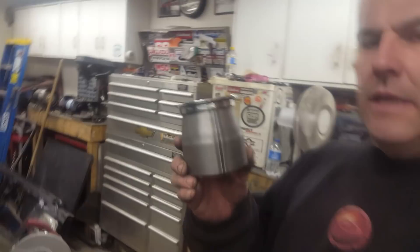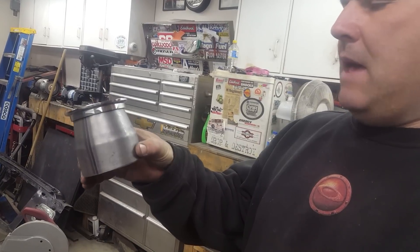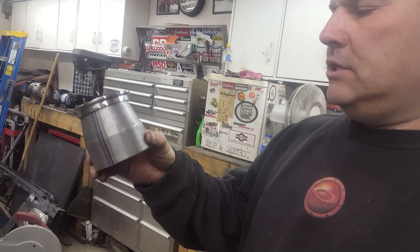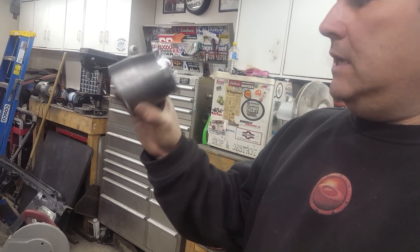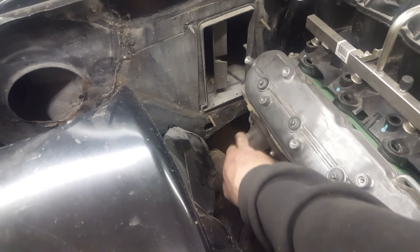I've got a V-band on there already. It's got a three inch outlet on the turbo — the VS Racing 7875. But I want to run three and a half inch single exhaust. So what I got is this adapter that goes from three inch to three and a half inch. I put the V-band on as tight as it'll go so there's less of the three inch section. Now I'm going to weld this on and then I've got a three and a half inch U-bend to mock up and see how it fits. That might be interesting to get it down in there because it's pretty tight. But if I have to, I'll cut some more of this here — even the firewall right there if I have to. That's no big deal.